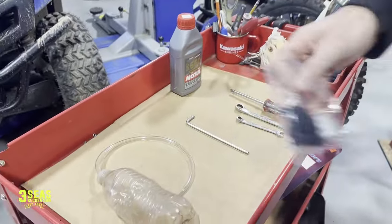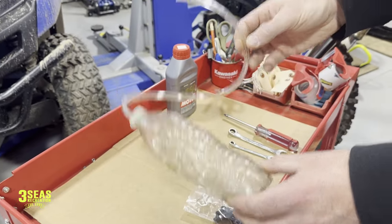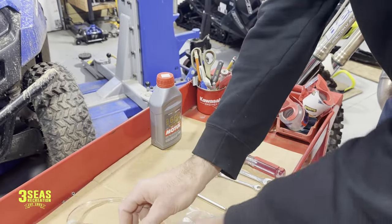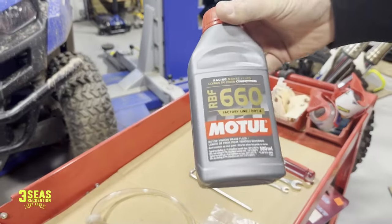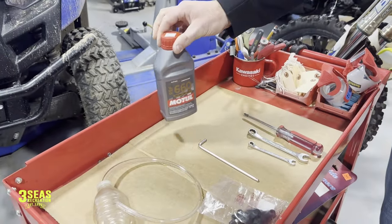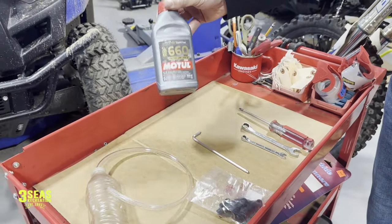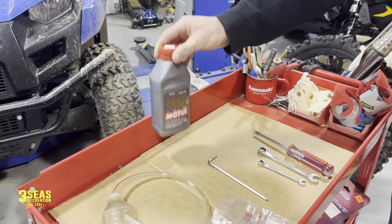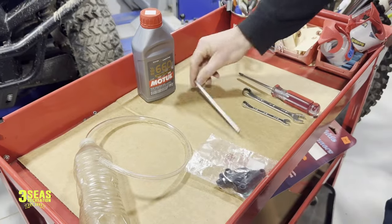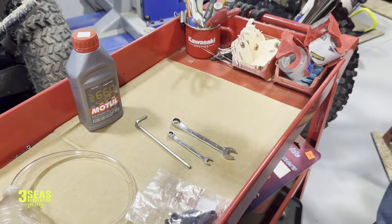This is all I'm going to need, so I'm going to do it the old school way. If you guys are at home doing this you can do it — it's like a $3 tool. I made this from a pop bottle with just some hose in it for bleeding. We like to run the Motul DOT4 660, and I recommend if you have a Beta you need to be flushing your clutch fluid every one to two years. If you race hard scrambles, you need to do this every year. If you're just trail riding, flush your fluid every two years. You'll need a 5mm hex head, an 8mm open end wrench, a 13mm open end wrench, and a good Phillips screwdriver to get your cap off.